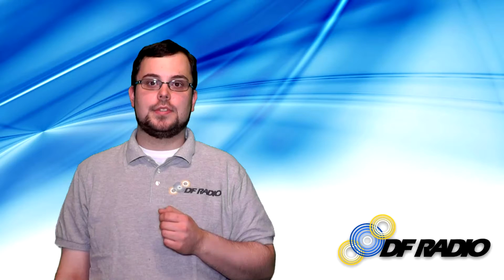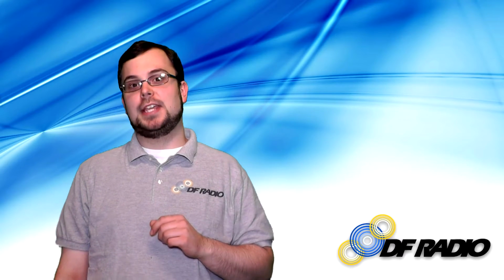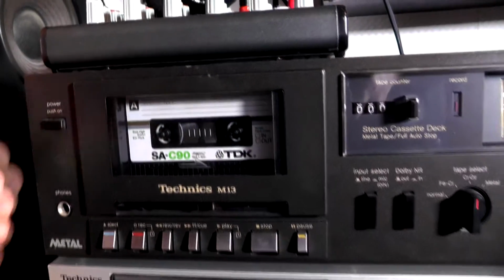There are some special things that this tape deck has which you will not find in newer tape decks. First, the nice VU meters, and the second is the motor. The motor works a little bit like in a reel-to-reel tape recorder, which means that it is constantly running when you power on the deck, whether you are playing a tape or not. All my other tape decks start the motor only when the tape is actually playing. The constant running of the motor produces a little bit of noise coming from the mechanics, but I really had to turn up the volume to make it audible for you.